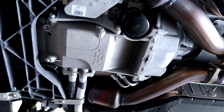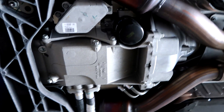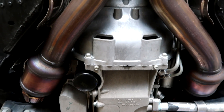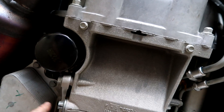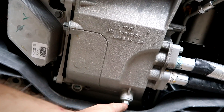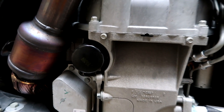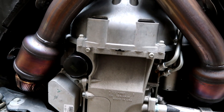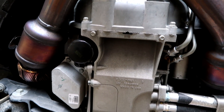First thing we're going to do is drain the oil. We just did a how-to video on the C7 — if you look into this, it's almost identical. Loosen these two bolts, do one at a time, then the oil filter, drain the fluids, and then we can go ahead and refill. These are a 10-quart system — I think it's 10 and a half quarts.